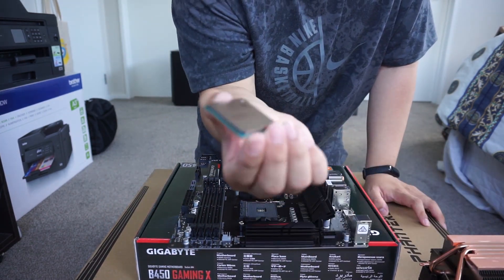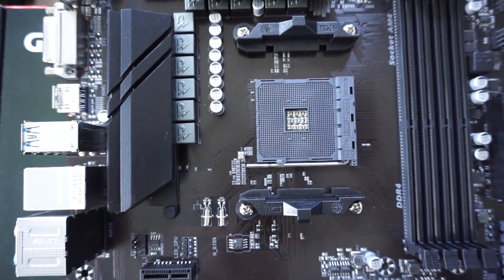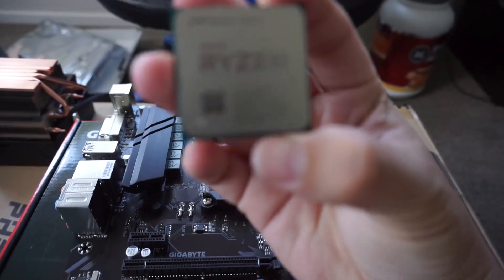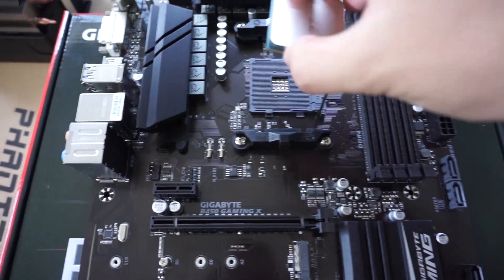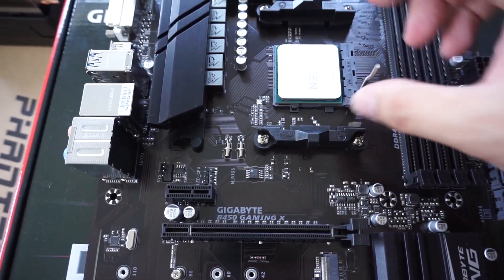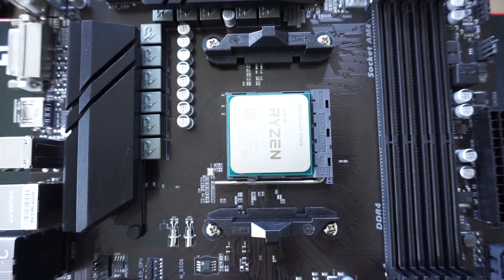How do you put your CPU onto your motherboard? Right here you'll see a triangle — you match it to the triangle on the CPU; it's right in this corner here. Before you do that, you need to open this lever — this is like a lock. You chuck in your CPU, give it a little wiggle, it should be in place. That's your CPU in.